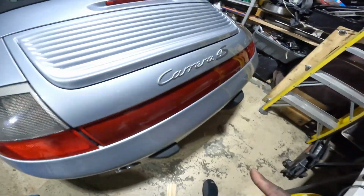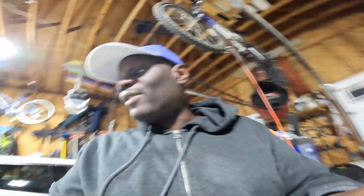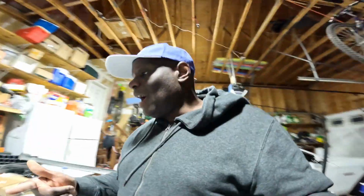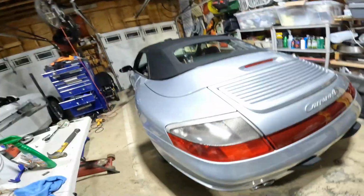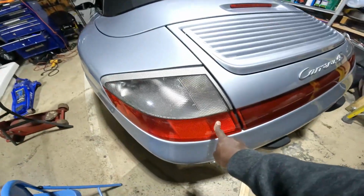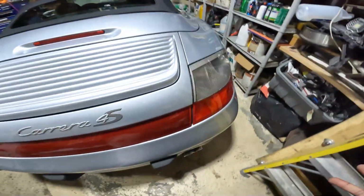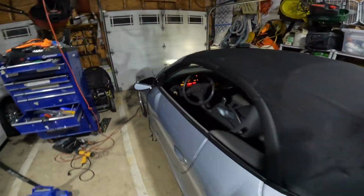So I have no tail lights. Let's turn it off again, turn it back on. Look, I have one headlight, and this was happening for a while and I couldn't figure out what it was. The answer is the headlight switch is defective, but I already went and I changed bulbs in the rear. I changed all my tail light bulbs. I had a mini bulb over there. So I changed both bulbs on both sides. Had to be done eventually. When I change the headlight switch, I should be able to get rid of that problem. So that's what I'm gonna do now.